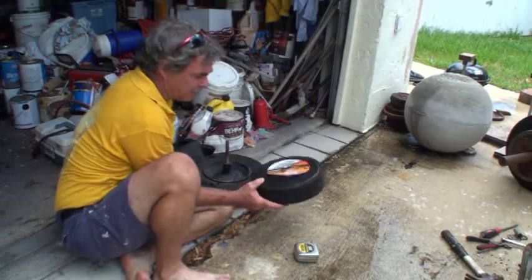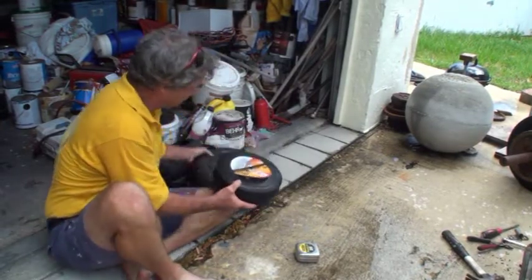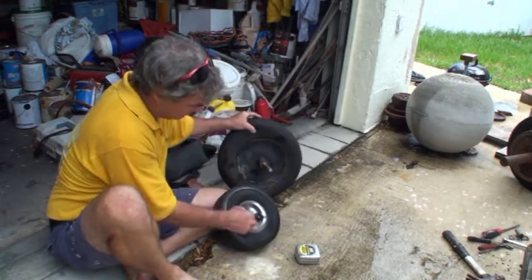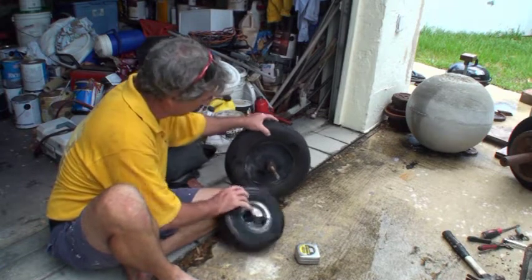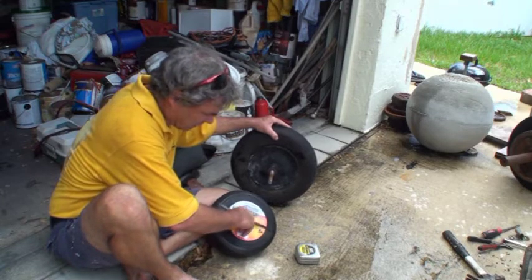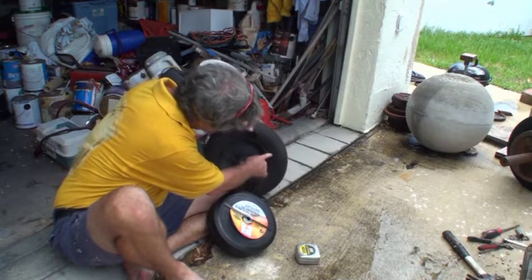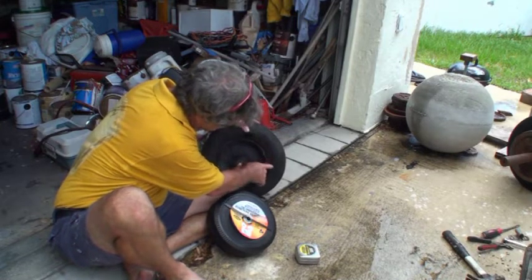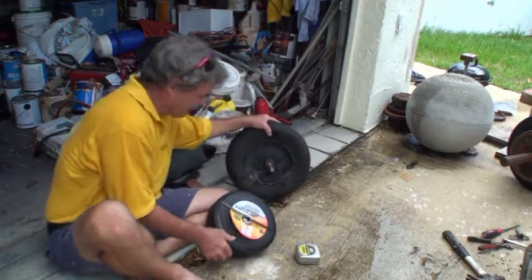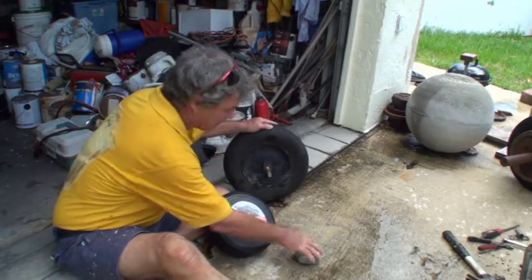Well, I was a little excited. I got the tire — $27. But it's the wrong tire. It fits the shaft — the 5/8 shaft is right, and they give you a lot of different options to go with it. But the problem is it said 'universal 10 inch tire' and it says 8 at the end — it's a 4.30/4.00-8. I wasn't sure what that meant. I assumed that was the overall diameter, but obviously that's bigger than 8 inches. I did not measure this, and if I had it would have said somewhere around 15 inches.